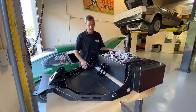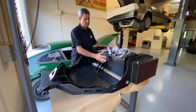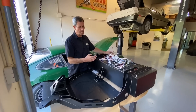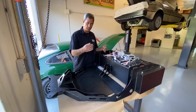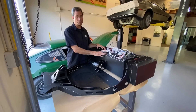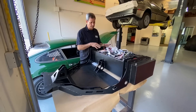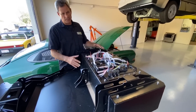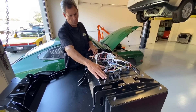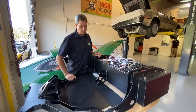We're going to take a closer look at the subframe outside of the car, and then we'll put the car on the lift to give you an idea of how we integrate that into the Porsche. Here we are at the rear subframe — we're lucky because we have one being assembled for another customer right now. You can see the contactor box without the lid on it, and you can see the parallel boards in here for the BMS. What those do is they allow you to hook more than one battery module in parallel while still independently monitoring each cell on our BMS — very important. We're sitting on 16 kilowatt-hour of LG Chem battery in the rear. There's another 16 in the front, so the car has 32 kilowatt-hour combined. You can see it sitting on top of the battery with a component plate installed, and then with a gasket and a sealed lid that goes on top to keep it free from ingress from the elements.